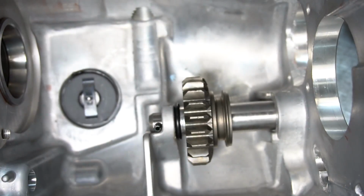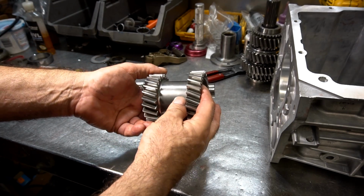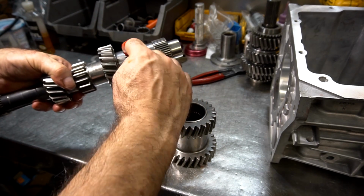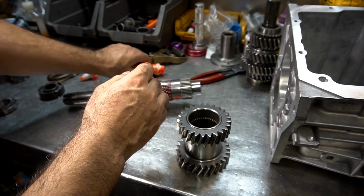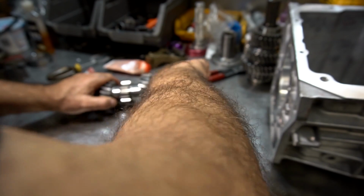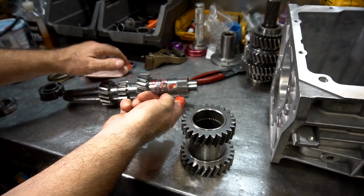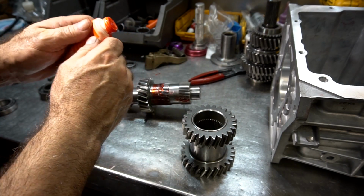That's fine. So I've deburred the counter gear stub shaft and the modular 3/4 section. But before I assemble them, I know this sounds crazy, but I put a lot of this anaerobic gel on these splines, because this will actually help keep this thing tight and reinforced in place better, because some of these fits are kind of sloppy, and I like doing this. If you have to take it apart, you're going to have to heat it up, but it's well worth it.